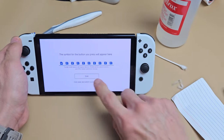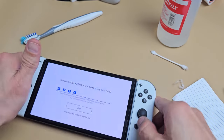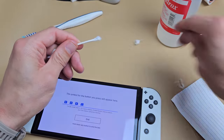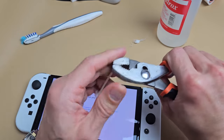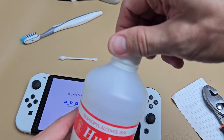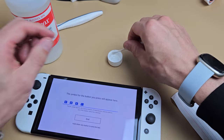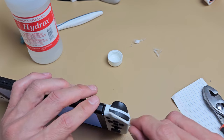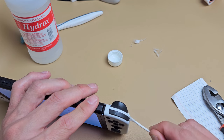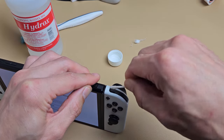Go back and recheck to see if it's working. If you have a Q-tip, take some cotton off, make it as flat as possible using a pair of pliers, then get a little bit of alcohol — just dab it — and try to get that cotton in there as much as you can. Especially if you have something sticky in there, go all around, even on the bottom, and keep pressing the button.